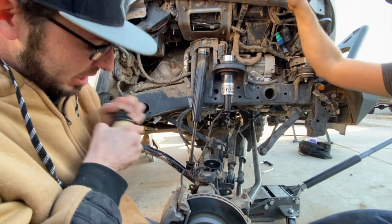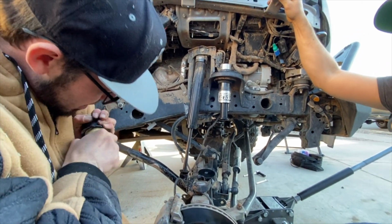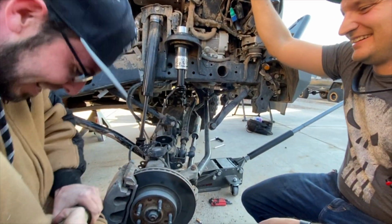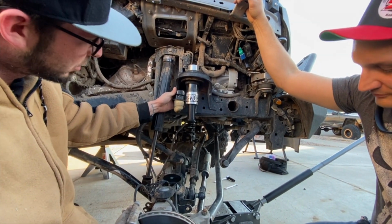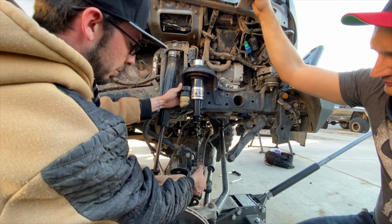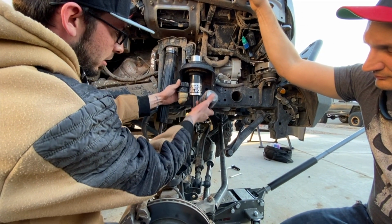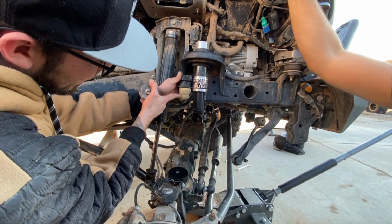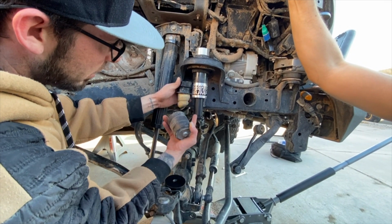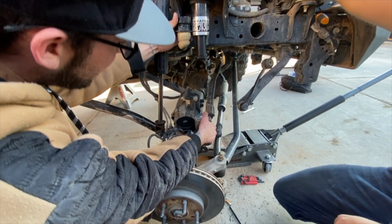What you want to do to set these speed bumps is, if you've already got your bump stops mapped out, well, that's not going to go back in there ever again. Let me spit on that a little bit too. I'm getting some lubricity here. Factory bump with the cutoff section, you're looking about that far. The Teraflex speed bump is definitely higher, but you want to be close to, if not a little bit less than, this guy, because when this guy collapses, that's the length we're looking for. Pressed all the way in, right where this divot is, is usually where they stop compressing. So this guy's got about the same range fully compressed as this guy. If you want to set up the bump, probably try it 2 pucks deep.